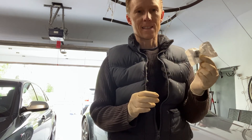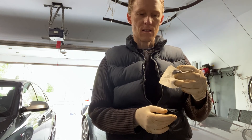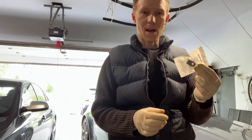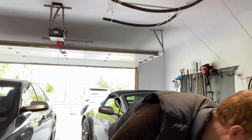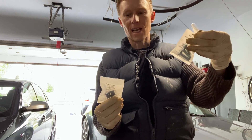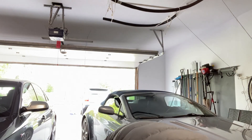When I removed the rusty bolts that held this in, these things completely disintegrated and fell out. I replaced these studs — these are from Lowe's and they're not exactly the right size, but these are 5/16 inch dash-18 thread. You can buy these at the store and then buy bolts that match. I bought a package of these little bolts — four of them — and tested to make sure they're a good thread match. These are also 5/16-18 and they slide into the car to hold it in place.